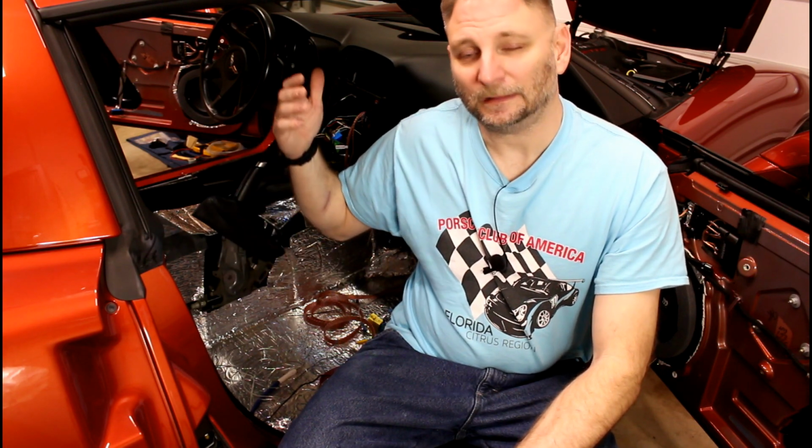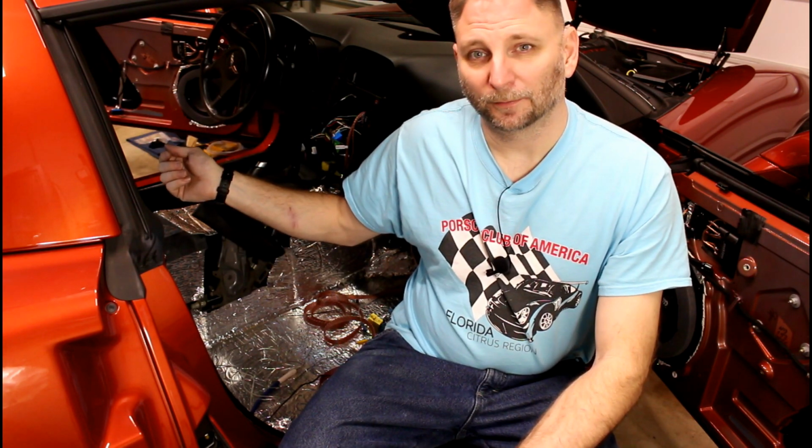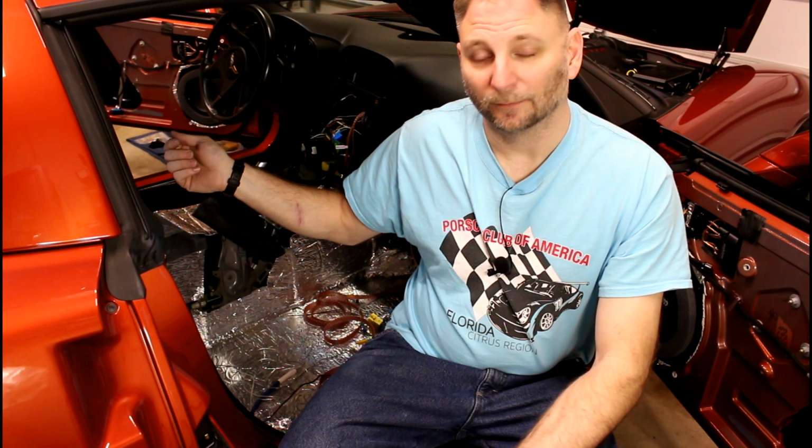So I made a mistake, and I was looking at the PAC wire harness adapter information, and I was looking at the Kenwood and the PAC, comparing them when I built the little harness, and I missed where it said in the Kenwood owner's manual, connect it to the backup wiring harness of the vehicle. I thought I could just tap into the purple and white wire on the Kenwood, or I'm sorry, the PAC harness.